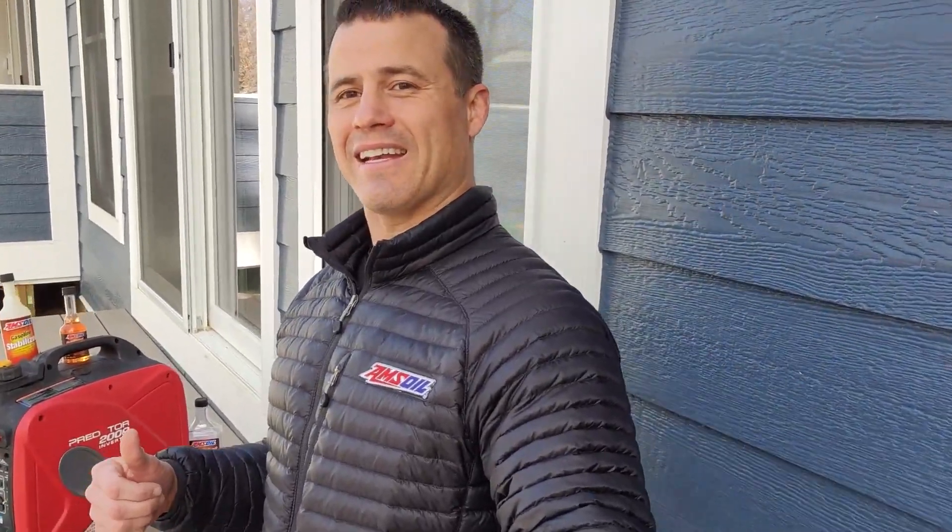This is what it looks like — comes in a little eight-ounce bottle. Here are all your instructions on the back. For larger applications you can get a quart bottle too. This eight-ounce bottle, if your application has never been treated, will treat six gallons of fuel on an initial clean-up — you double the dose. Instructions show a clean-up dose and a maintenance dose. Double it the first time: one bottle, six gallons. Once it's clean, you only need half as much — one bottle for every 12 gallons of fuel.